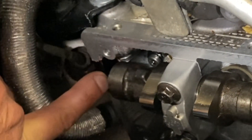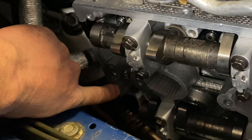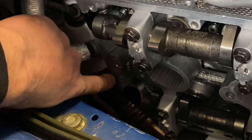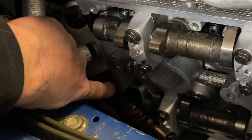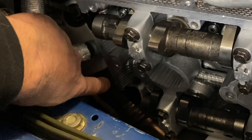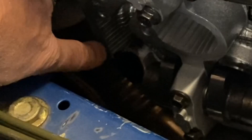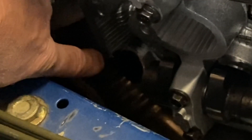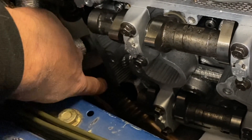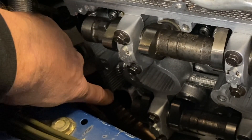You remove the little half moon right here, which is the upper one for the intake cam, and there's another half moon down here on the exhaust cam. That exhaust cam half moon is definitely the one that leaks the most because that's where the most heat gets trapped in this engine. That spot where all the oil pools up is where that little plastic half moon gets heated and shrunk over and over again until it finally deforms to a point where it's no longer going to hold the oil seal. Even on a totally stock non-performance engine, it's really common to develop an oil leak right there even if it was installed correctly 100,000 miles ago. Putting these billet half moons in instead of plastic ones, regardless of whether this is a performance build, will actually make your engine more reliable and last longer without developing an oil leak from the valve cover seals.